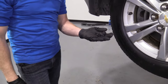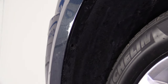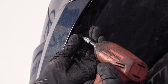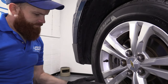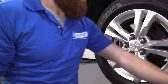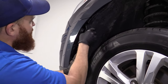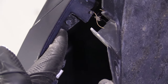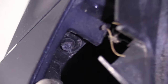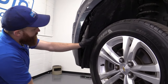Got our push clips set aside. Got our T20 here and here. They both look the same — easy peasy, can't mix them up. That feels pretty great. Take a peek under here — we've got that bolt right there. I'm going to grab the size for that real quick. Once we get that out, we're going to do the same exact thing for the other side of the vehicle, and then we'll lift it up more and grab everything from underneath.